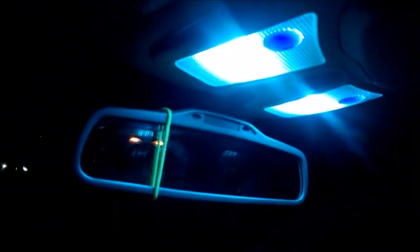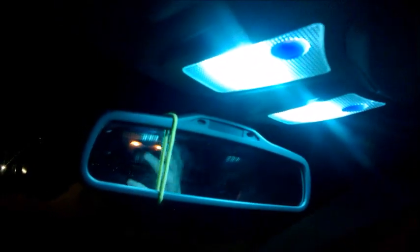Let me just turn this off completely. This is how it looks — you always have this kind of dim reminiscent light. To me it doesn't really cause a problem, but some people have actually soldered a resistor on each LED and that causes it to shut down completely. I'll put a link in the video description with this mod. But other than that, I really don't mind it and it's just fine. Thanks for watching.